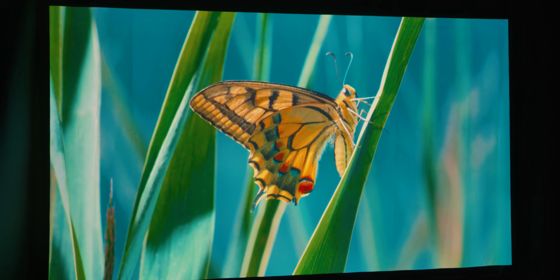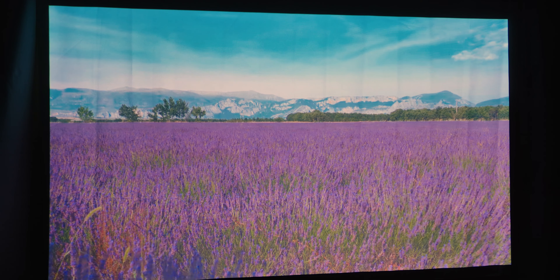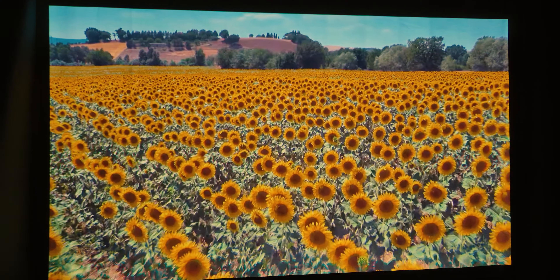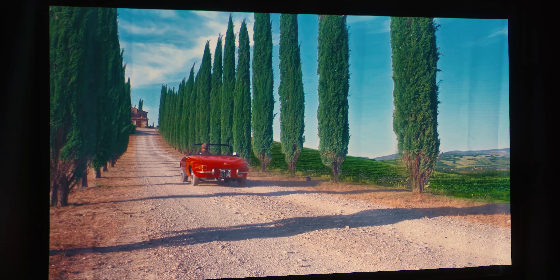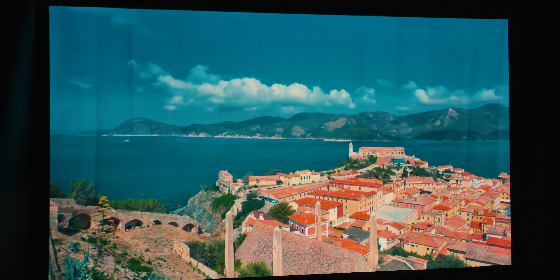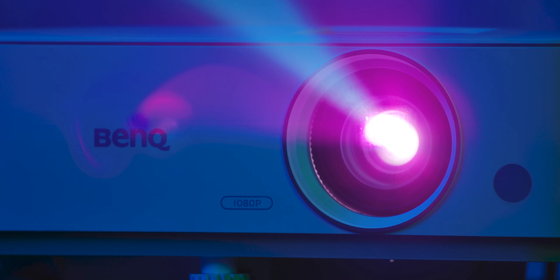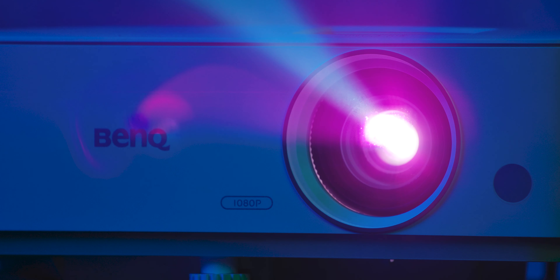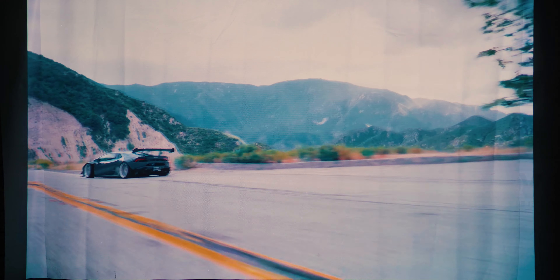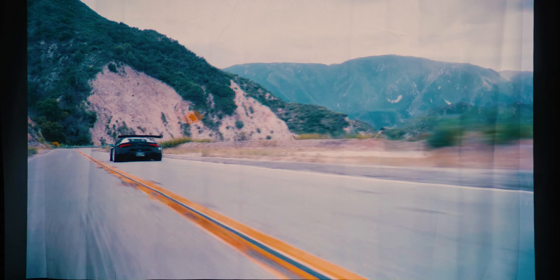Unlike 4K TVs, the resolution offered by this projector is Full HD or 1920×1080 pixels, which may not seem like much compared to big-screen TVs or 27-plus-inch monitors. However, on LCD screens with big panels and lower resolutions you can see individual pixels, which doesn't look nice. With a projector those pixels are not visible due to light scattering on the projection surface, so the overall result is much more acceptable — similar to what we had on CRT panels, which also displayed lower resolutions just fine for the same reasons.